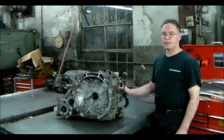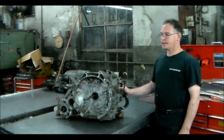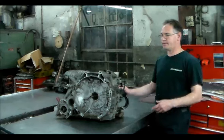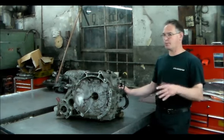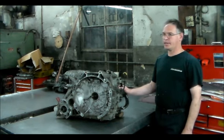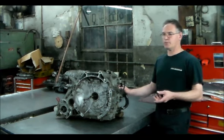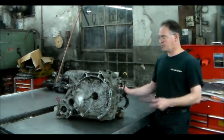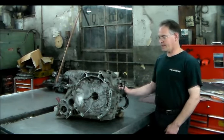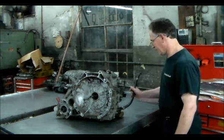What was going on with this is when the car was hot, it worked okay. But when it's cold, you drive it, it's really not shifting. Then all of a sudden, after it's stuck in first, boom, it shifts into gear. After that, it felt like it would be starting out in third, but not really in failsafe because it was commanding first. So I'm sure we're going to find something coming apart, possibly some clutch pressure control valves that are hanging or sticking, something to that effect.